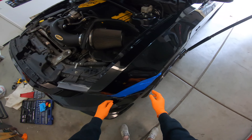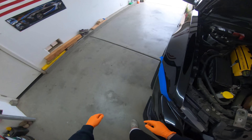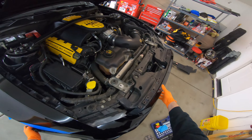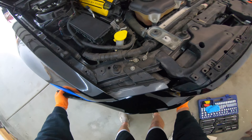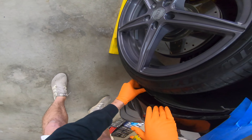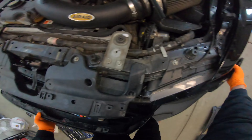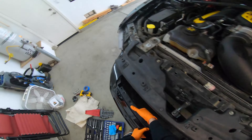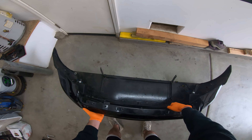I should have taped that off. One thing I did do is tape off the fender — I do this every time I pop off the bumper because sometimes it'll flop up and slap it. After everything's disconnected you can just pop it — be careful of your clips. The bumper started to fall and I had to disconnect the side markers that I forgot about while holding it one-handed — total fail. Don't want to yank those cables. Bumper landed.